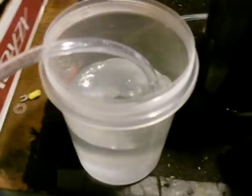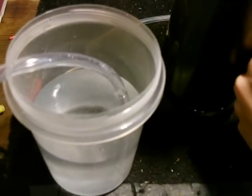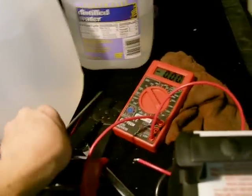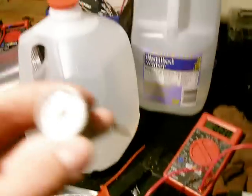So I'm going to go ahead and touch this up — and we've got HHO. Checked it with five plates at seventeen amps, putting out one liter in a minute and twenty seconds. Not that good, but hopefully later more plates will do it. Water temp was at I think one thirty-five after about ten minutes running.